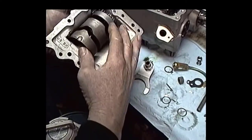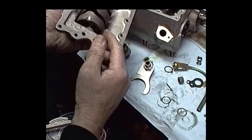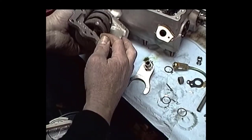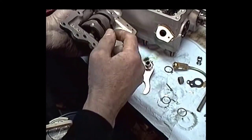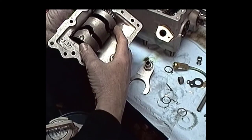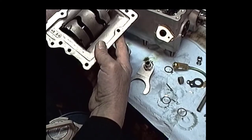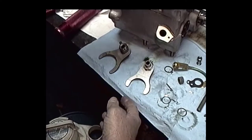But anyway, the drum, there's a little sleeve that goes in this drum, and the sleeve is loose, and I had to repair that, bush that sleeve up. Plus, I had to make some shims out of shim stock. I got about 4 thousandths in play right now, which is plenty good. So I'm really happy with the way this is coming out. So we'll get back with you.